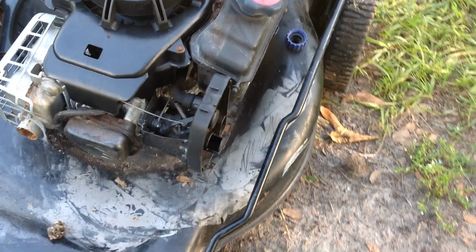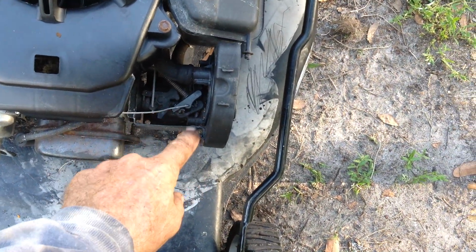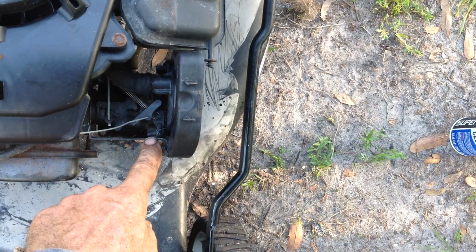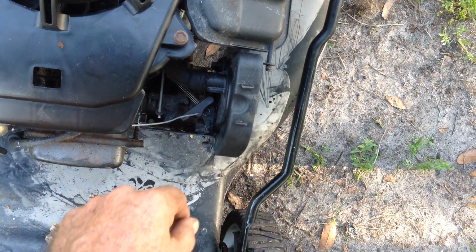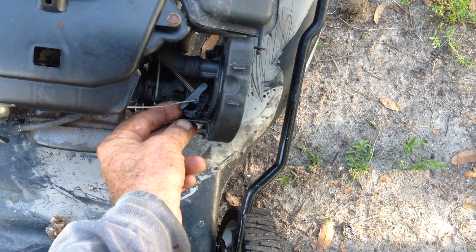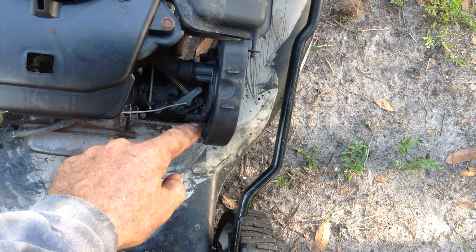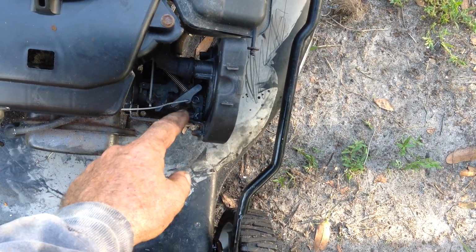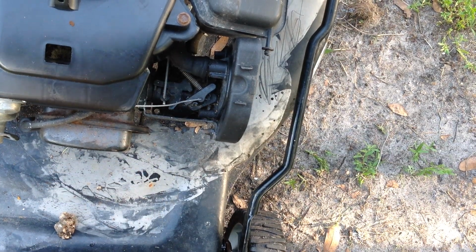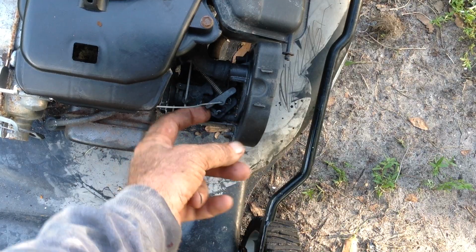The choke was stuck in the full open position. This is another common problem with these plastic carburetors. There's been some videos on them. You got to bend out right here on this bracket, because what happens, this choke lever comes up here and you can see it just locked itself. Another trick is when you have the carb off, take a file and just shave some of this plastic off right there, or take some channel locks and bend this metal back a little bit. Because what will happen, this will go to full open position, stays here, you go to start it, it's going to be difficult to start. So I usually take a file and shave the plastic down so it freewheels back and forth.